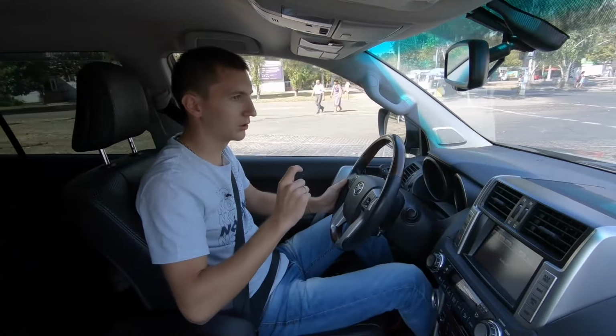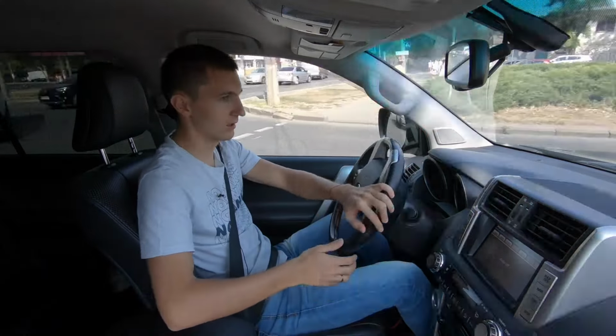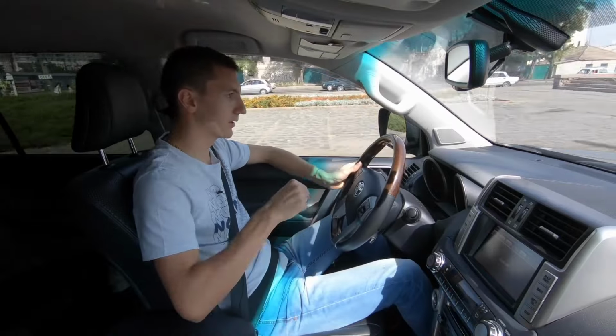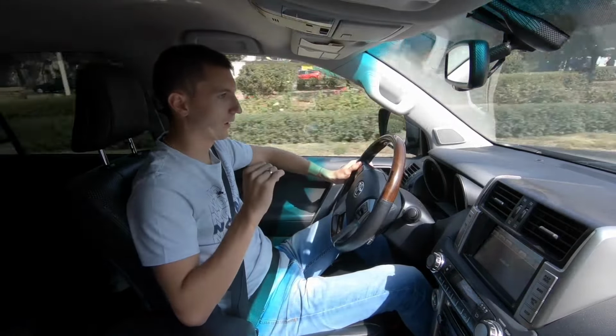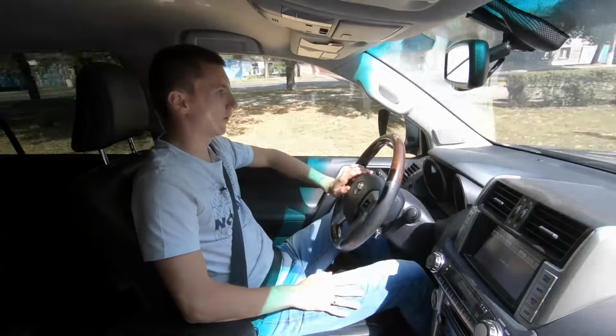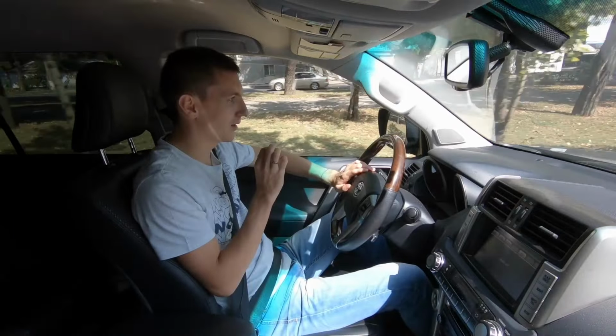KDSS is not always worse. On small bumps where there are a lot of them, when the wheel starts to jump, vibrate and these unsprung masses show themselves negatively, with KDSS the car behaves better, the wheels jump less. That's really how it is. Moreover, if you nitpick, those who are really into it probably notice that the car is not symmetrical.